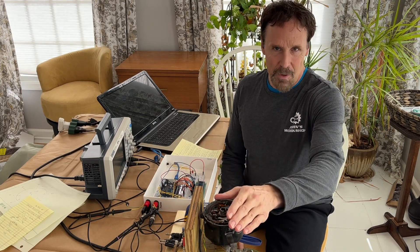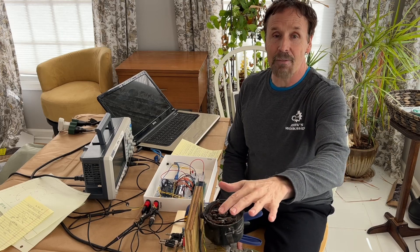If you're still watching, thanks for hanging out through the whole video. With this test distributor from eBay, we saw that every other cylinder was off by about six degrees of distributor, which would be 12 degrees of crankshaft — pretty significant. If we had put this in a car in its current state when I received it, it's not going to run too well. Our next step is that Chris just got his distributor back from the rebuilder — we're going to put his distributor in here and check how well that rebuilder did. He was replacing bushings and may have straightened the shaft.